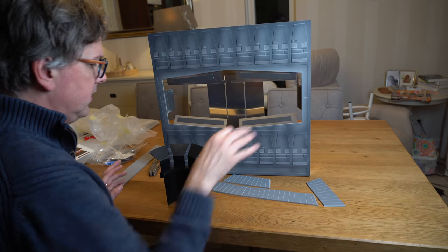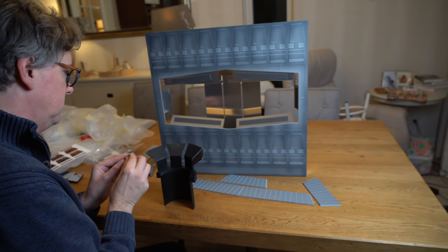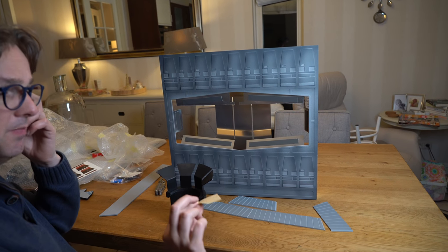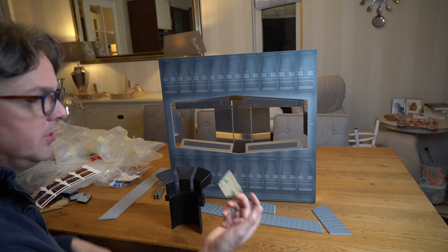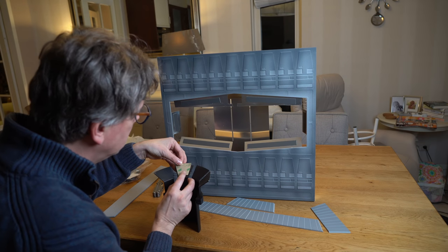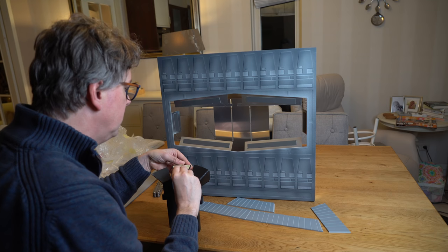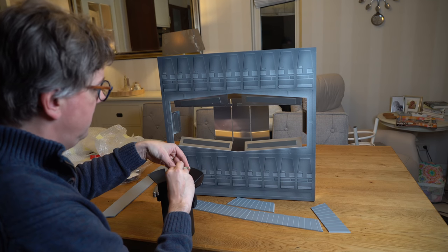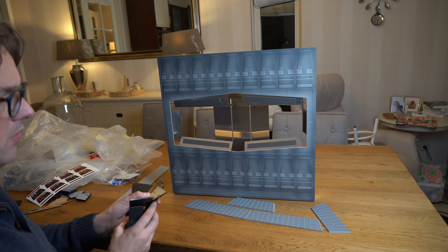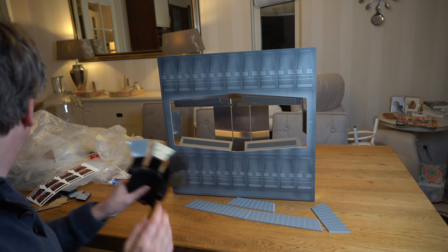So while we're working on this, it's good to have this 3M stuff already mounted on the metal for the panel. This is pretty unique stuff. It's basically just glue, and usually there's double-sided tape, so there's a carrier material, but that's not the case here. As with all glue, you want to give it time to set. So just apply one layer of this stuff, and you have to take off the layer without the 3M logos first, stick it on there and leave it on there, so when we're ready for it, the glue will have adhered the best way possible to the metal.